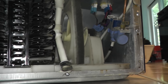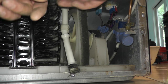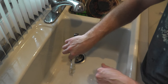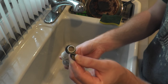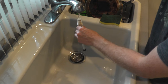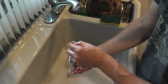Let me move the camera so you guys can see this better. By the way, I just unplugged the fridge — this is not hot by any means. Now just to show you how clogged this is: on the bottom of this valve there's a ton of debris. If I just flush some water through here — as you can see it's just completely clogged, and that's why water is going on the bottom of the freezer and on the floor.